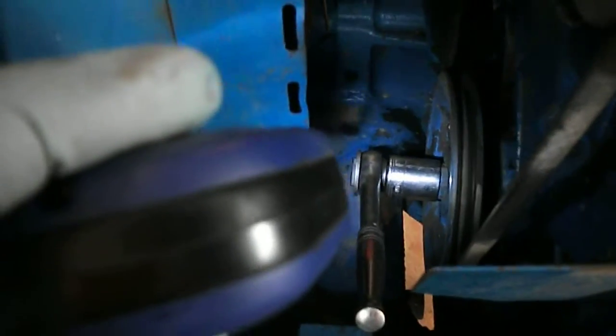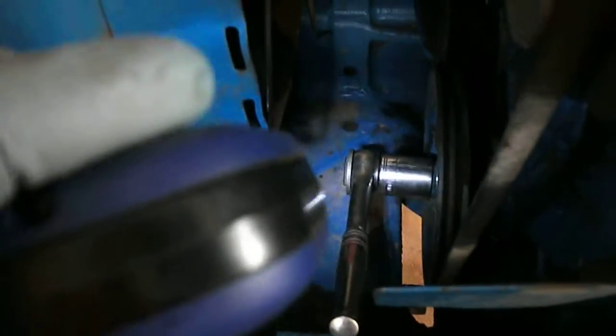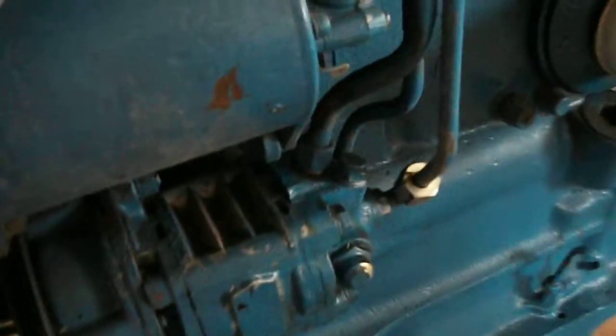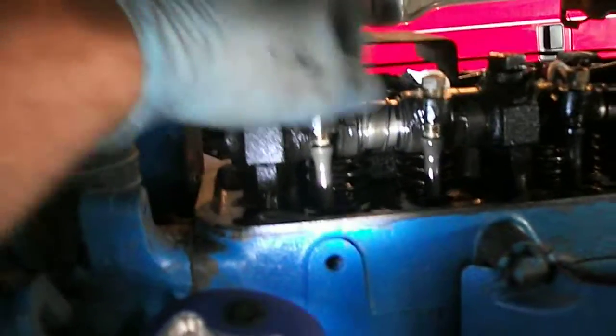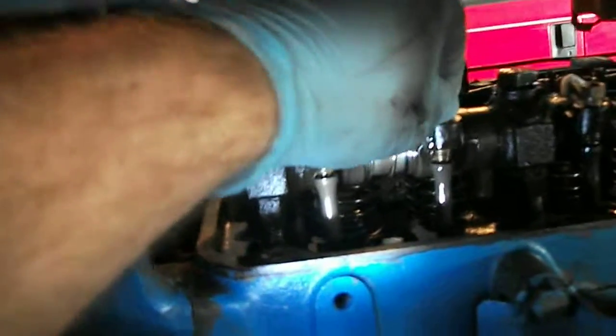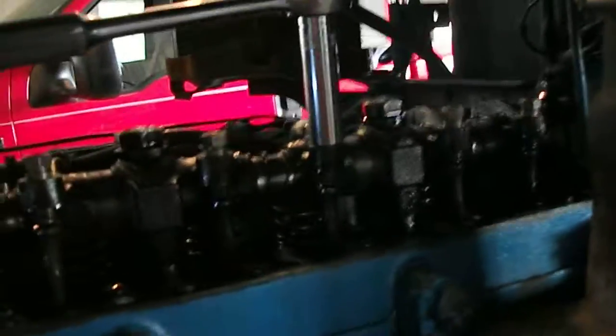This one's easy so you get your wrench right on the crankshaft without any fighting. It's pretty good space in there. I actually have number one cylinder at top dead center compression stroke. As you can see both valves are closed and the rocker arms are loose. That would also mean that number four, being the paired cylinder of number one on a four-cylinder, would mean that both valves will be slightly open, which is valve overlap.